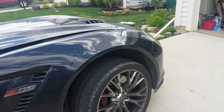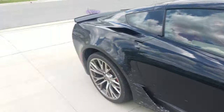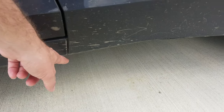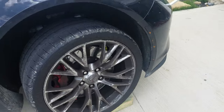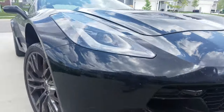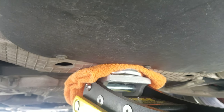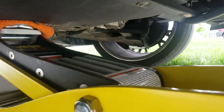We're gonna talk about putting heat exchangers in the front of the car, but first we wanted to show you how easy it is to lift up a car in your driveway. Here we are in a driveway — nothing fancy. We just need a floor jack. What we did first was we lifted right here at this lift point, raised the car up enough to put one block underneath the passenger side tire. We don't bother with the driver's side tire. Once we have that wheel on a block, we slide the floor jack underneath the car dead center.